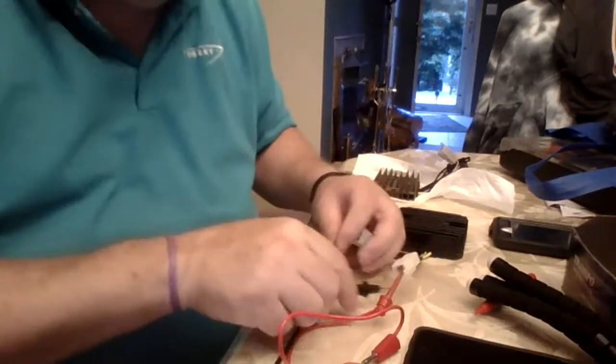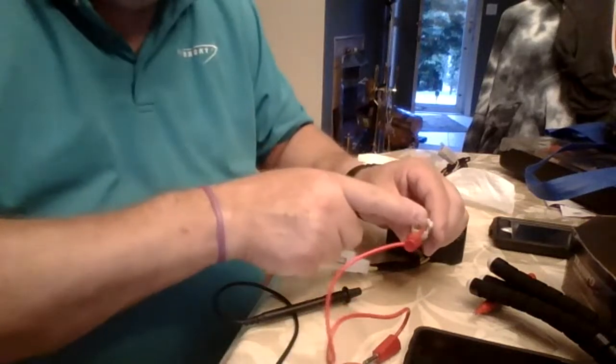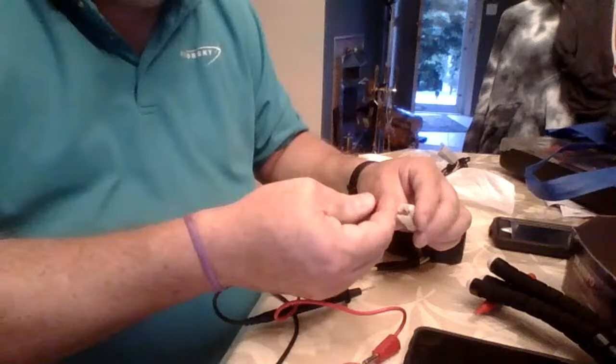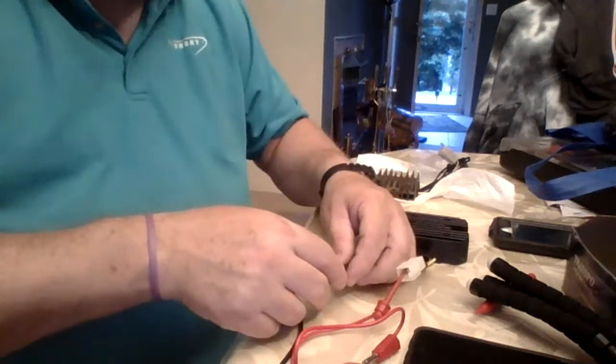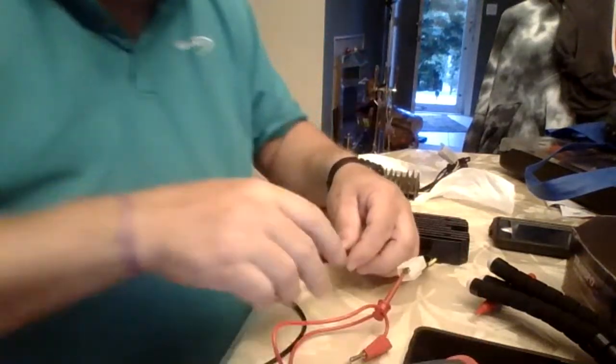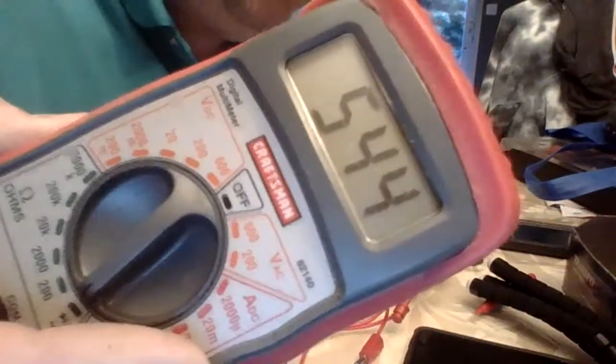In that direction, with the electrons going positive to negative, we're good. Now testing in reverse — coming off the negative lead of the plug that goes to the capacitor. First stator lead: 543. Next one should be close — 544. This brand new rectifier regulator tested almost identical to the numbers from the burnt one. So we know this brand new regulator is good, and comparably the burnt one is good too.